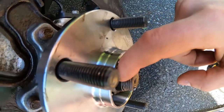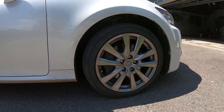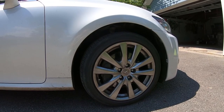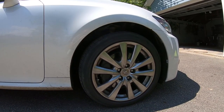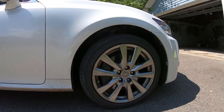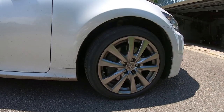The wheels are back on and I'm about to go test drive this to make sure we did it right and that there are no knocks or unusual sounds. When you get in the car, start off slowly and make sure it's quiet with no unusual noises, then as you slowly gain speed continue monitoring for sound. Make sure the steering wheel doesn't shake or sway to any one side — although it might because alignment might be thrown off a little bit. When you replace the hub, you should feel like the car is performing much much better and all the sounds, noises, and vibrations you heard before should go away.